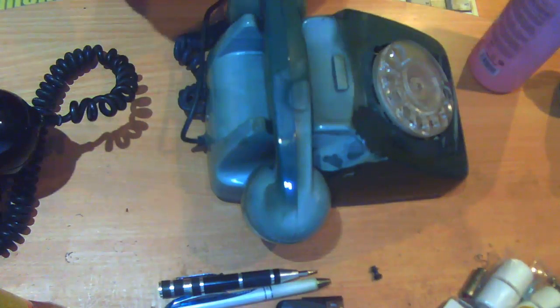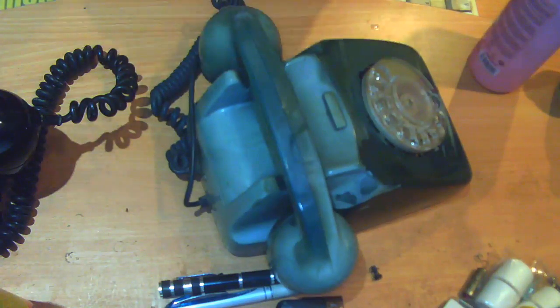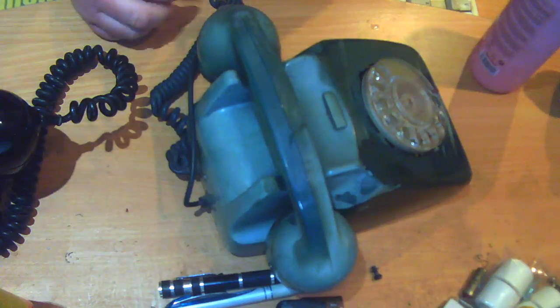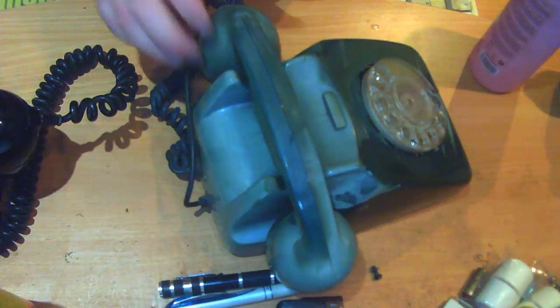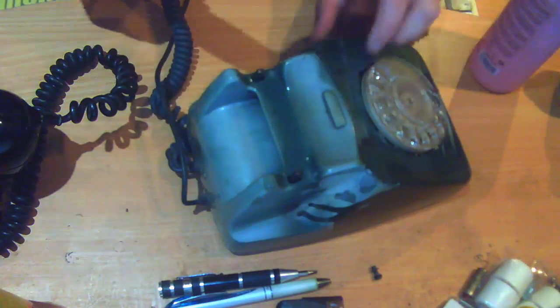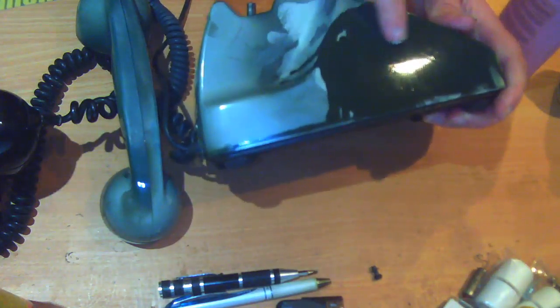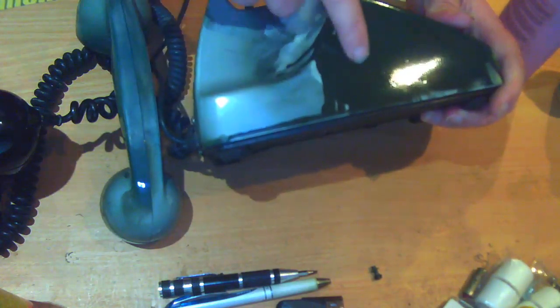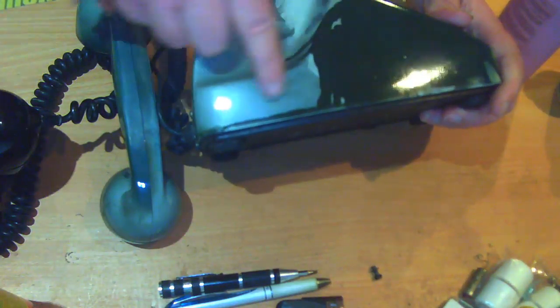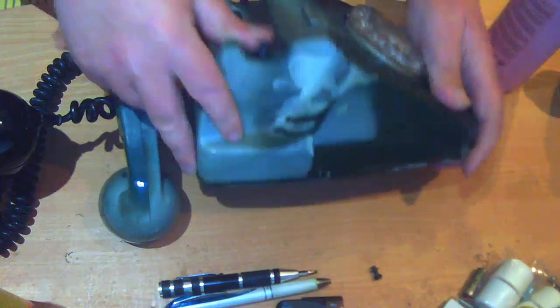But of course the acetone evaporates quickly, so you're kind of just left with the water. Now, the bit I'm doing, of course, is at this end, which you can't see very well. But does it look any better? I have to say, to my eyes, it doesn't. Because as you leave it, it seems to go white again. So there's something odd going on with the plastic of this phone. Now, it's got a few streaks on this side. This is where I just dribbled neat acetone down it, and you can see here it's come out nice and shiny. Now I'm wondering if you could spray neat acetone on. If you could take the case off and just spray the acetone on with a very fine spray, because where I actually washed it with acetone here, the discoloration has gone, but here I think we're going to struggle to get rid of it.